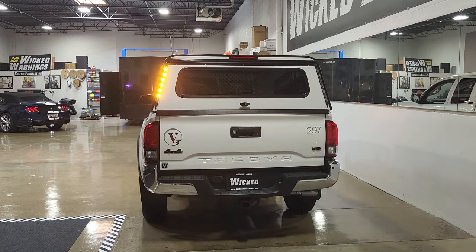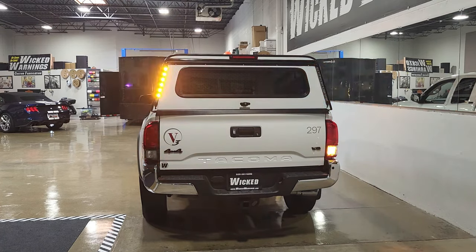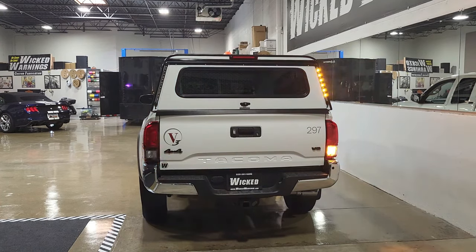On the camper shell: two Thin-X strips (15-5s), four of the new Mini Hex lights, and an additional 30 feet of 22-5 to run the mini hexes together, synchronize them, and extend the mini strips. Using some of the extra 16-2 you can connect everything down to the driver's tail light and borrow power off the 18-5 you're running to the rear hideaway lights. That 18-5 is more than enough to power the hideaway lights plus everything on the camper shell.